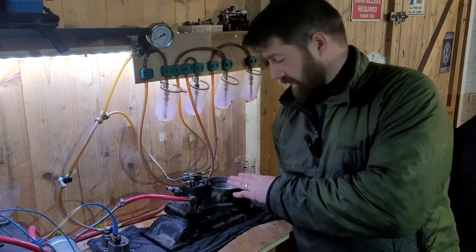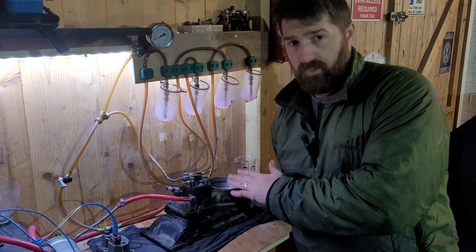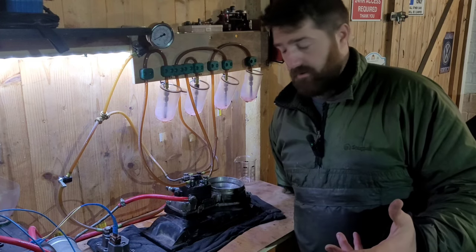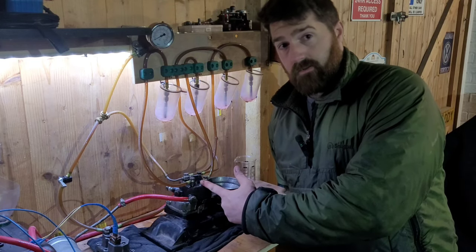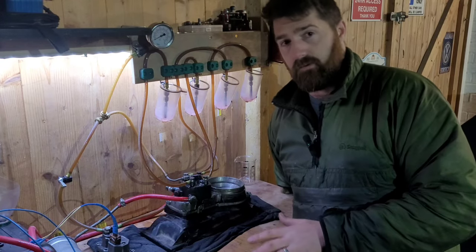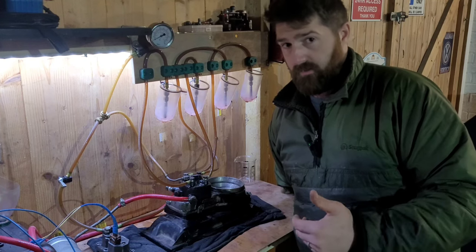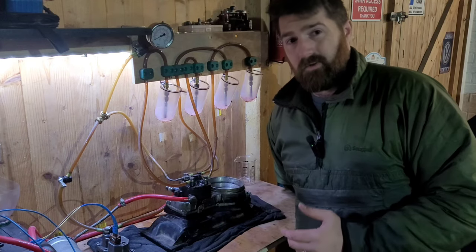This flap may only reach three quarters of its potential lift with a 125 brake horsepower engine, so there are slight differences in system pressure. This is rigged up just fuel in, fuel out. These do have different connections for the fuel systems on the Porsche - like the fifth injectors and other components - so all you can do is go through the main system pressure.